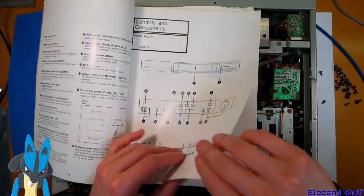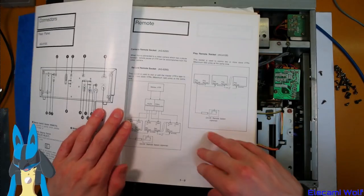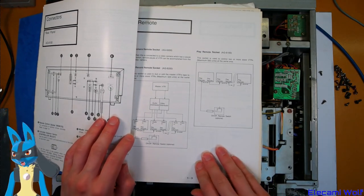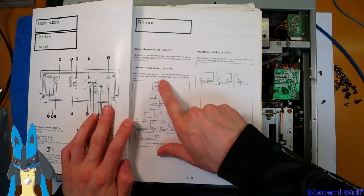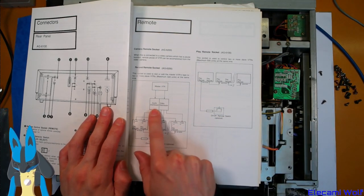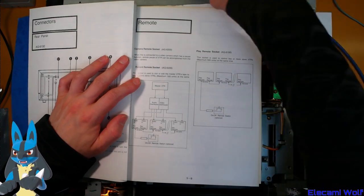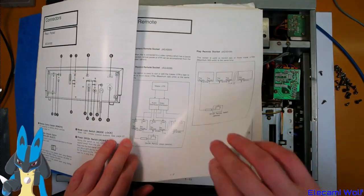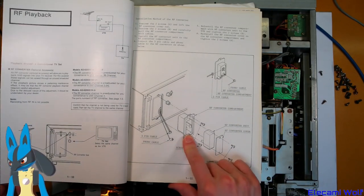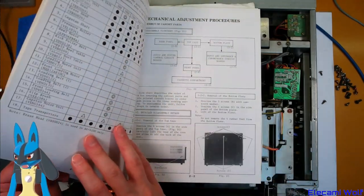It's on that really nice smooth paper they used to use — good old early 80s stuff. There's the RCA record remote connector we saw on the back. It says that's for dubbing or edit from master VCRs. So you can use a distributor, and that signal can trigger the start of recording — and probably the stop of recording. The RF modulator is an optional thing which you can plug into the back on that model.